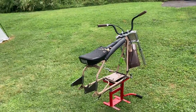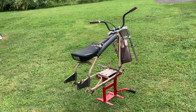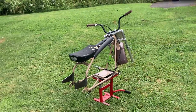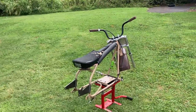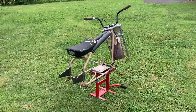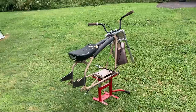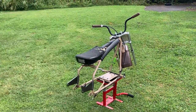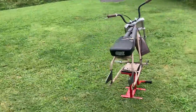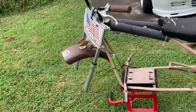I'm thinking about getting the frame ready first. I'll keep the eight-inch wheel and go with a 15x7x6 Hoosier slick in the back. Up front, I'm debating between a 10-inch skinny wheel or a six-inch rim with a 15-inch tall tire — more like what's on the Big Rascal. So a skinny tire up front and the big wide tire in the back.